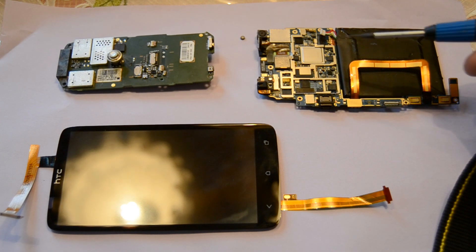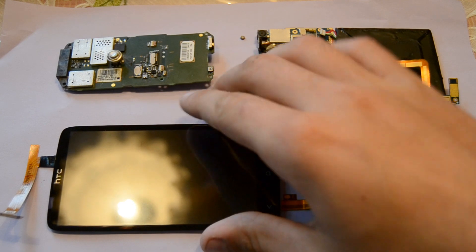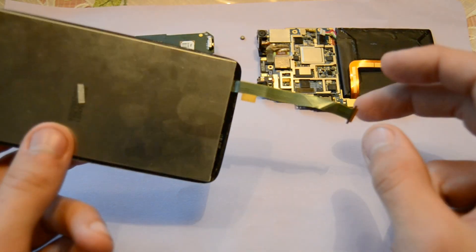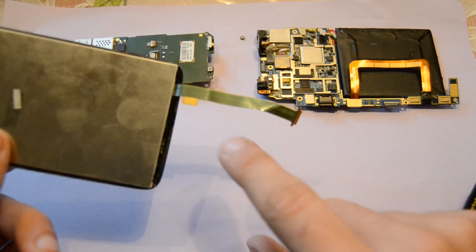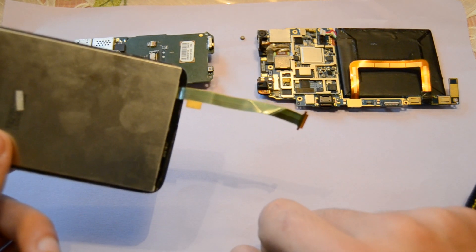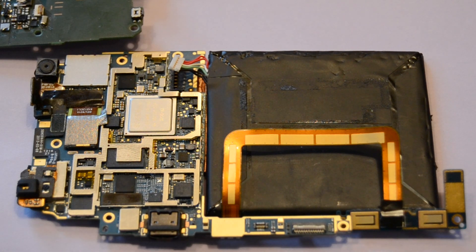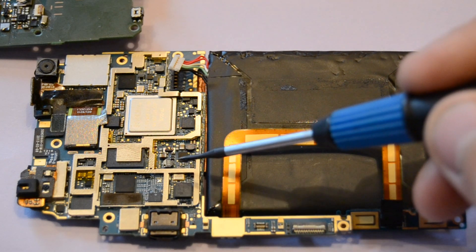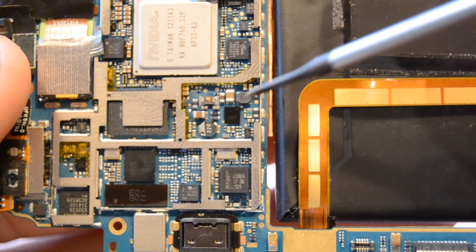Now I'll show you where to find this coil on your mainboard. Here I have the old Sony Ericsson phone from which I took the replacement coil, and here's the replacement screen from China. As I said, I got the wrong screen with the wrong flex cable — I got the green Sharp flex cable when I had the Sony one, and that may have shorted out my 220 coil. Here's the mainboard and here you can find the 220 coil — it's this little component just to the left of the IC, and the IC is just to the left of the other coil. Make sure you re-solder it in the correct direction.